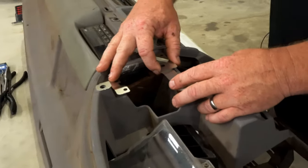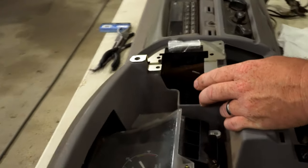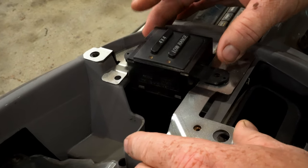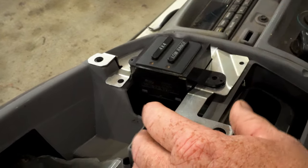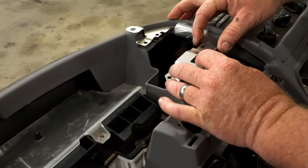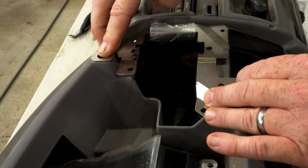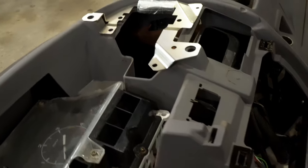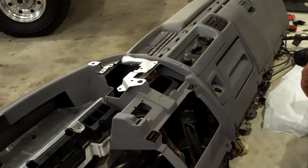This is the replacement panel for the wait to start light, water and fuel light. And also if you have push button four-wheel drive, it also alleviates that problem. Your wait to start light would mount here. The push button four-wheel drive mounts in here. You do have to drill a hole on this one. Essentially line up these holes, and you have to drill a hole right here. And that comes with the necessary hardware, a little screw and a little clip in there. So another great fix. It takes all the pressure off of the dash bezel, especially if the plastic stands are broke off your dash bezel.